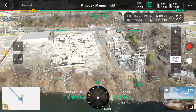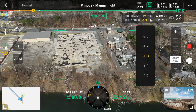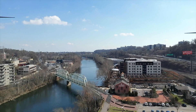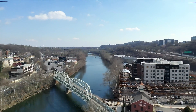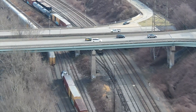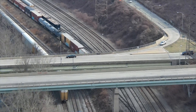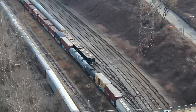Looking at some field examples, I noticed the wide camera image seemed a little overexposed, but dialing back the auto exposure adjustment made it much easier to see with increased contrast. The wide camera really isn't useful for much beyond flying around — 1080p is plenty of resolution to navigate. The zoom camera, on the other hand, gives you a much clearer image. It has double the megapixels, shoots at nearly 2.7K, and the dynamic range is far superior. My workflow has been to fly with the wide camera and quickly toggle to the zoom camera using the on-screen button when I want to get a closer look at something.